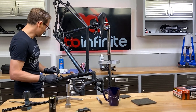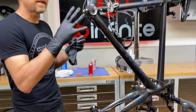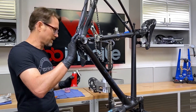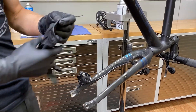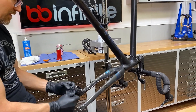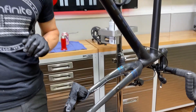Before we start reaming, which we'll do in our next video, I want to show you something very important. This bike has disc brakes, and we're going to be putting oil and solvents up here very shortly. If any of that gets on these pads, they will be ruined. Whenever you're doing something like this, I recommend taking a glove and putting it over the brake to protect it from all the oil and stuff that's about to get on there.